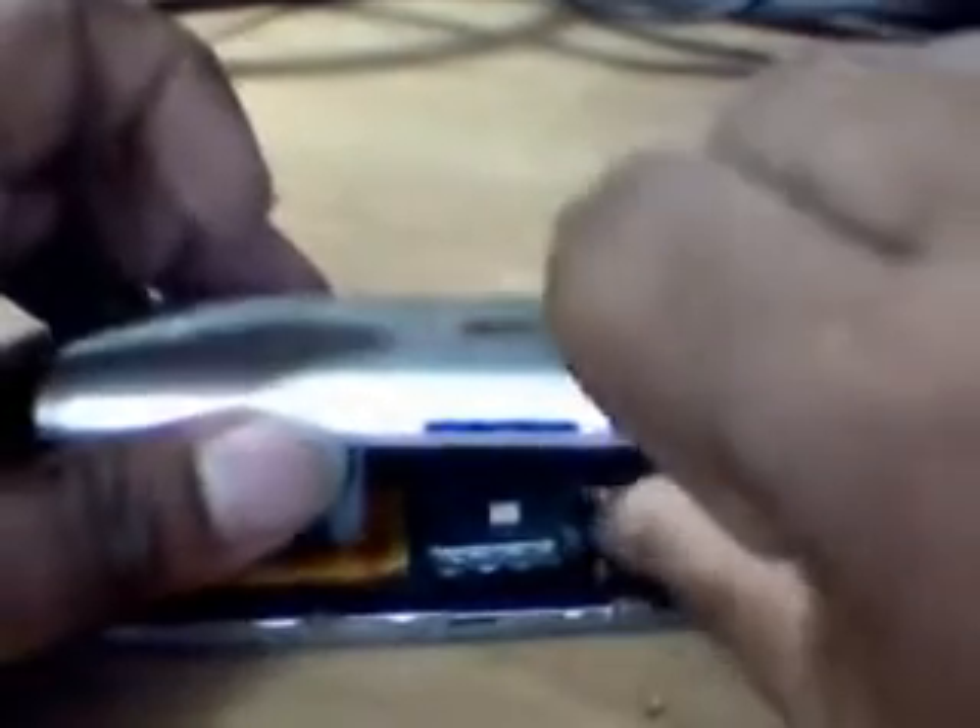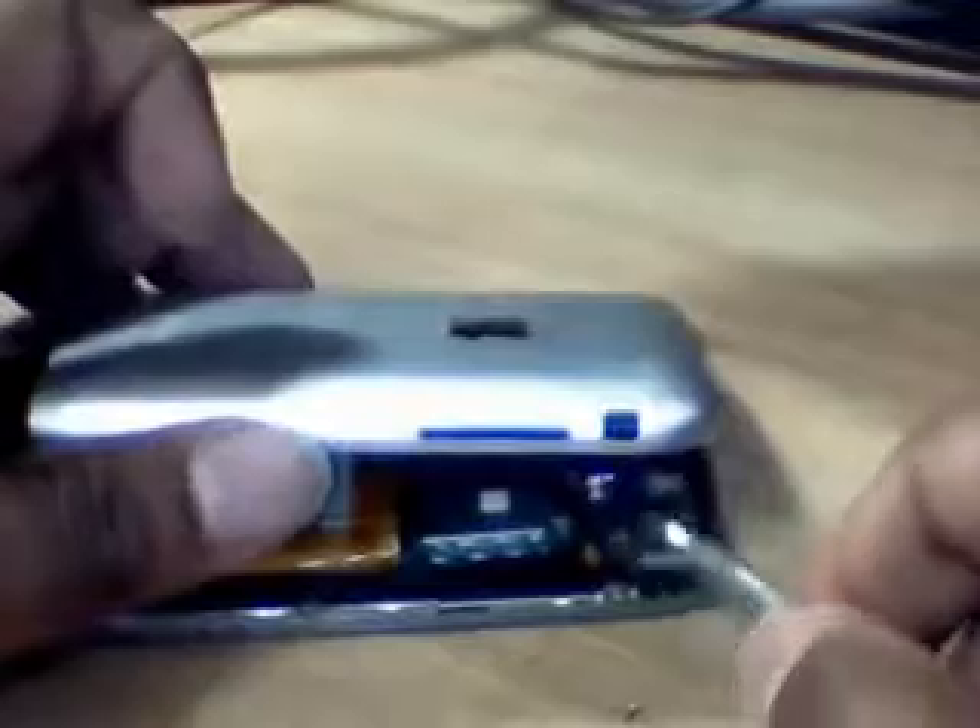The iPhone is off now, so once again we will pull off this particular connector. You also require this small magnetic catcher, which helps you to catch the small screws very easily. Now we will remove the battery from the iPhone.